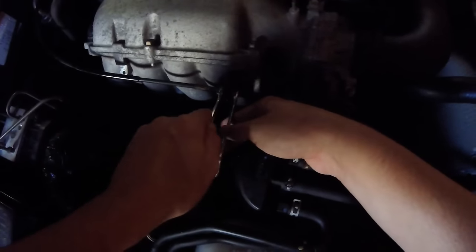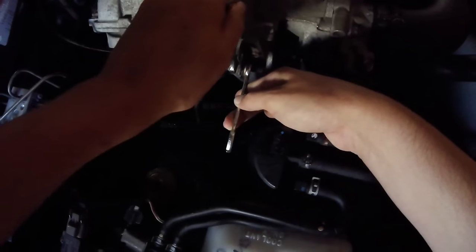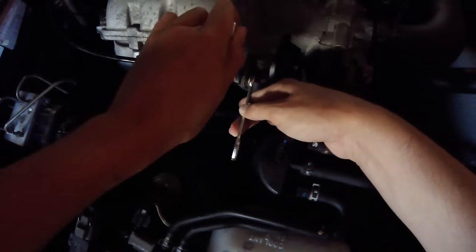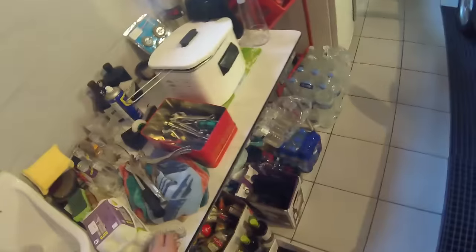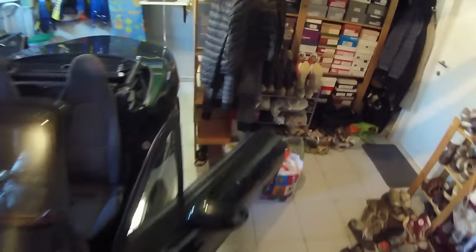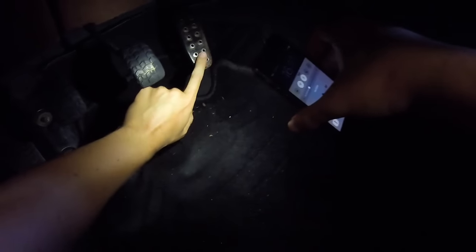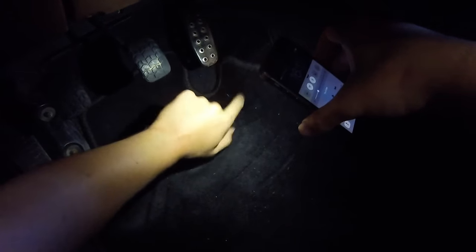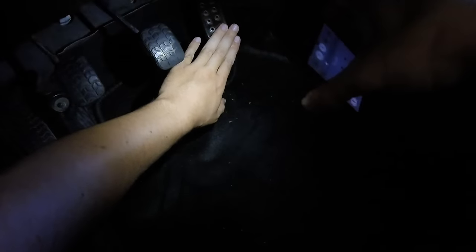It's really hard to reach with your wrenches, so you can only do about one turn or half a turn at a time, but at least you get the job done. It's tightened and still taut. Now let's take a look at the gas pedal to see if it still has play in the first half inch. As you can see, I tap it and it's not budging — it just stays there, and when I press it it's instantly giving gas. That's how you fix a dead pedal. This is a zero dollar, two-minute upgrade and it really improves the driving a lot. Thanks guys!